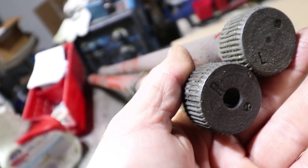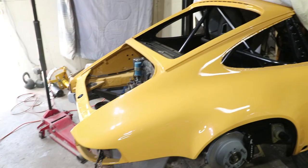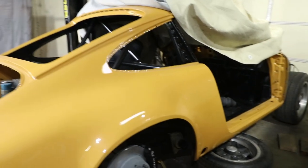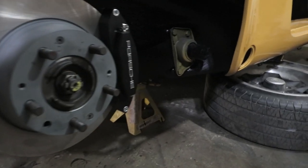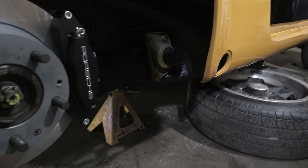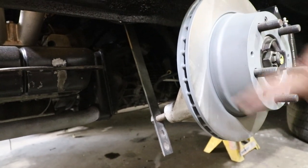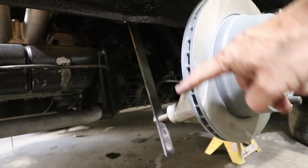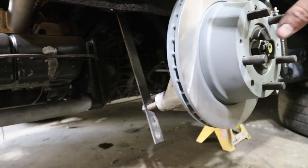The ends here are marked right and left, so that makes it easy to get them installed. The car is up on its jack stand. That's where the torsion bar goes — right there where there's the hole in the body and that yellow spring plate bracket. Up to now, doing all the work on this car, I've just been using this long solid shock — basically a piece of angle iron drilled there — and that's what's holding the suspension in place.